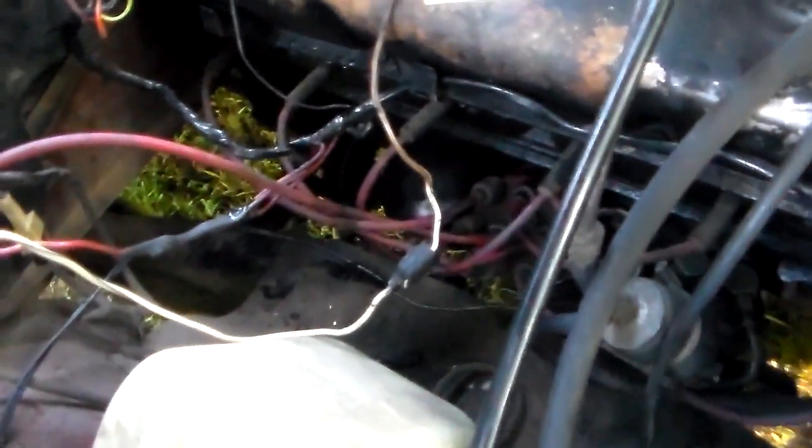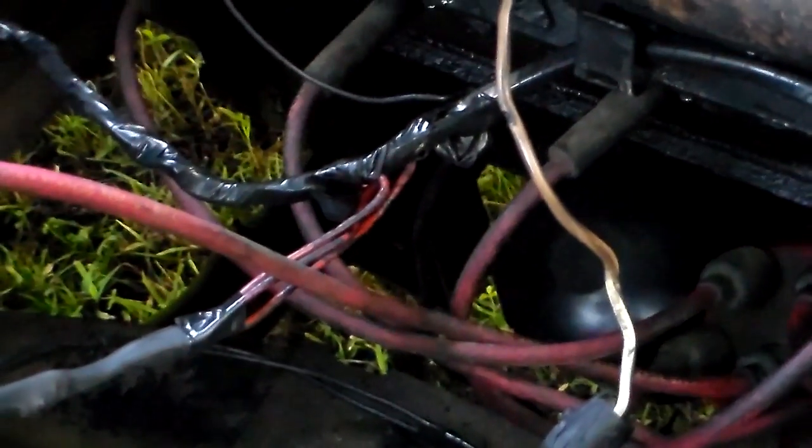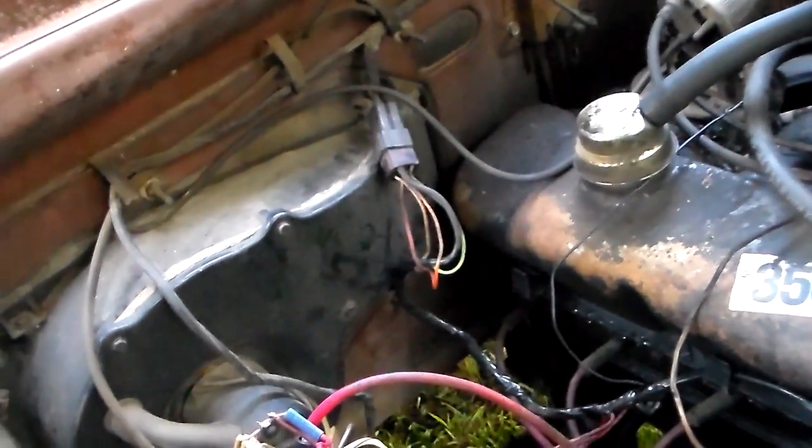Let's take a look at this wiring over here. When I was talking about this red wiring earlier, I said some things that were erroneous — not really, but I didn't really know what I was looking at. Coming out of this plug from the rest of the harness, you've got a red wire, a tan, a kind of orange, a green, and a big black one. The big black one goes to your alternator — that's your B-plus, that wire is always hot whenever the battery is connected. The green wire is one of your field terminals to the alternator, the orange wire is the temperature sensor wire, and the tan one is your oil pressure.